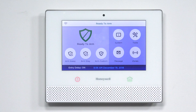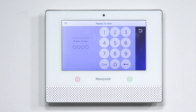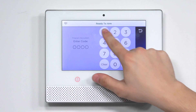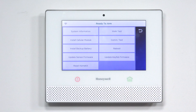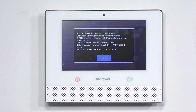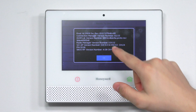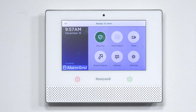Press Security, then press Tools, and this time type in the master code — default master code is 1234. Once you've done that, press Advanced and go back to System Information. If it has updated successfully, you will see the current firmware version on the top right where it says Rev, R-E-V. The current firmware version is 01.07.07648.491. Once you've confirmed that, press OK and hit the Home button to go back to the home screen.